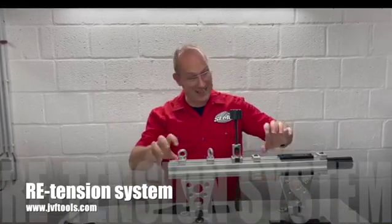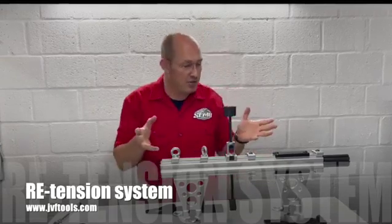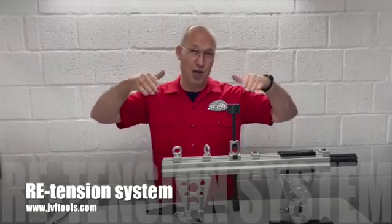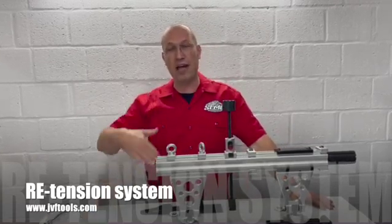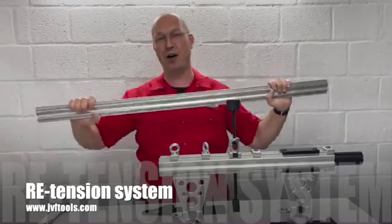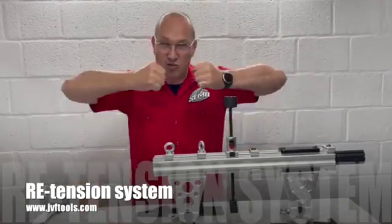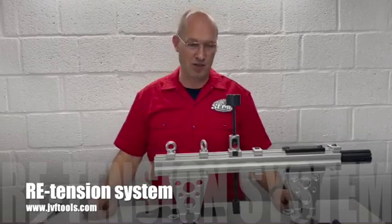The tool is made from machined aluminum — it may seem heavy but it's actually quite light being all aluminum. When you start using it under various angles, previous extrusion designs weren't holding up, so we had to improve. We ended up with a grab-on extrusion that is tested to over a thousand pounds per extrusion, allowing this tool to stretch up metal and apply retention in the directions you need to bring the metal back to original.